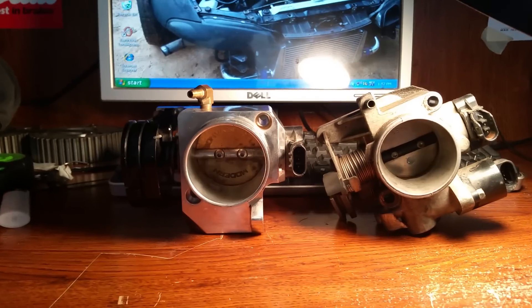In that situation, if you're going to run it unmatched, it's more or less eye candy — you're probably better off just sticking with the stock one. The real need for a bigger throttle body is when you get a really big turbo that's pushing a lot of air and you want to keep it flowing better where the stock one is starting to restrict you. Bigger cams and other things that need more air — that's when you need to start upgrading to a throttle body like that.